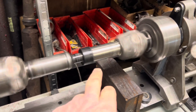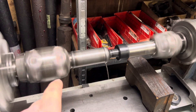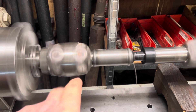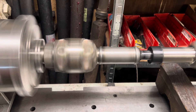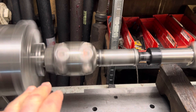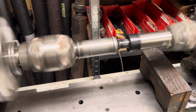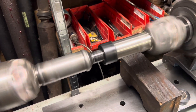That is a Neapco slip yoke, 1310, and the H-yoke on that one is a PTI. There was a period during COVID where I couldn't get the Spicer H-yokes, and I had that on the shelf, so that's what I'm going to run. The rest of it is Spicer — ball stud yoke and the soft centering device, three 1310 Spicer snap tights. 17 and a half inch, center to center.